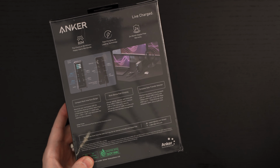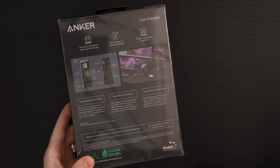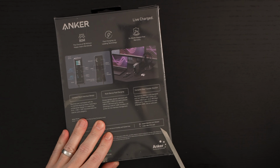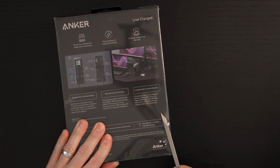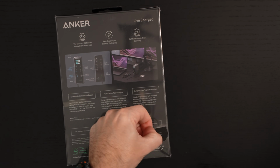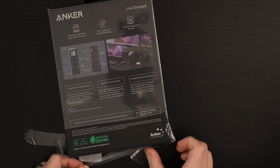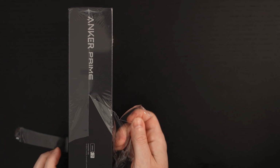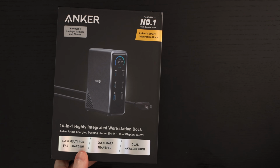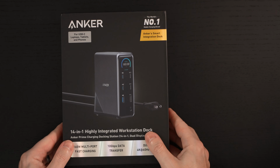In fact, those of you who only need up to 100 are going to be satisfied, and that is the majority of users because, well, there are devices out there that do use power delivery 3.1, but they certainly are few and far between when compared to traditional 100 watt power delivery, which is still very much the standard. Well, in the realm of Apple, you can exceed it, but most devices that people are charging, certainly phones, are never going to need more than 100 watts, cameras, tablets, all of that good stuff.